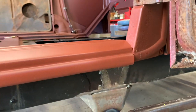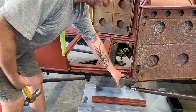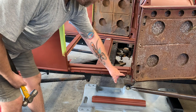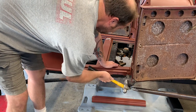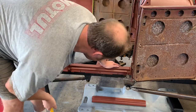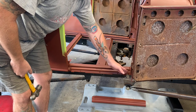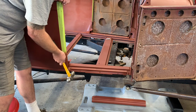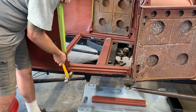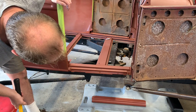This little tab is sticking out way too far, and the only way to get it to go back in is with brute force. As you're hitting it with the hammer, you're just kind of eyeballing the distance between it and the body line that it's meeting up with. That's about right. Now we need a little teeny bit more primer. Let's recheck this fit.